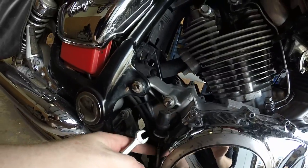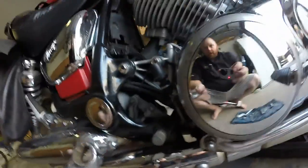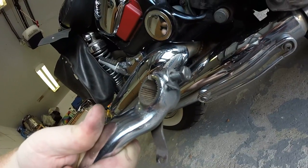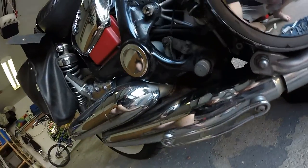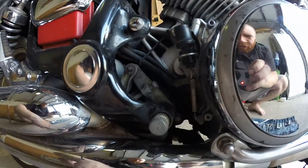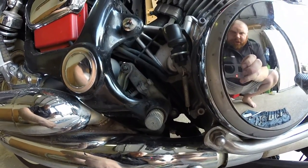This is the brake light switch. There's also a little notch on the top — I hope that's in focus — which helps you line up to the little dot up there, so that you know your brake pedal is replaced at the correct spot.